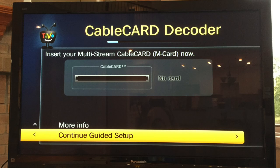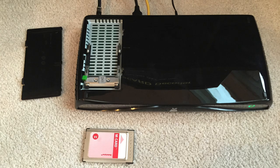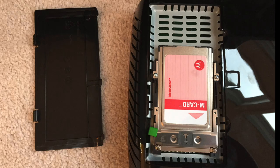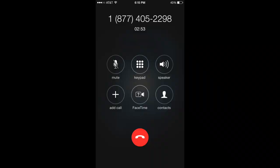After that, your TiVo will ask you if you have an M-Card. You should have acquired one of these from your cable provider ahead of time — it is small and fits into the palm of your hand. Without unplugging the TiVo, turn it over and pop off what looks like a battery cover. Behind it you'll find space for the cable card to be inserted. Insert the cable card, put the cover back on, and turn the TiVo back over. You'll then see a screen with a bunch of numbers on it, and it will also have the phone number of your cable provider to call at the top. They need to add your M-Card to your account.